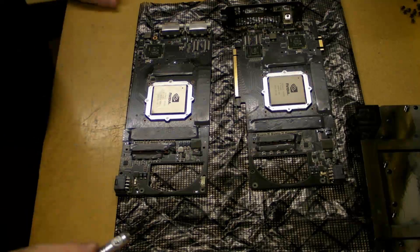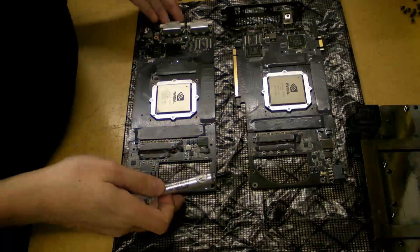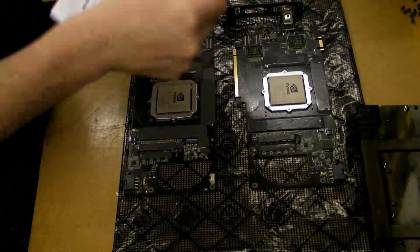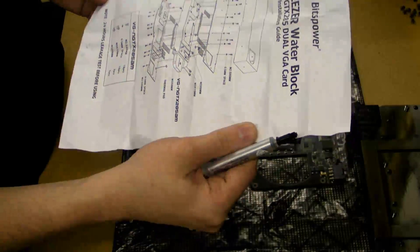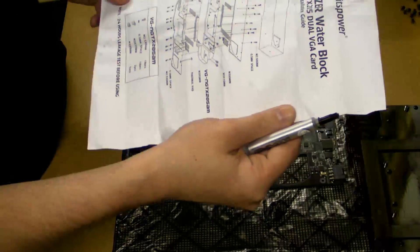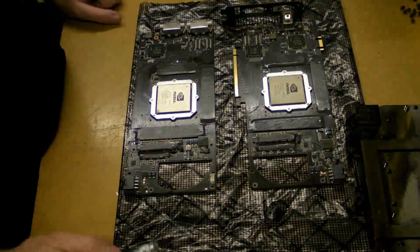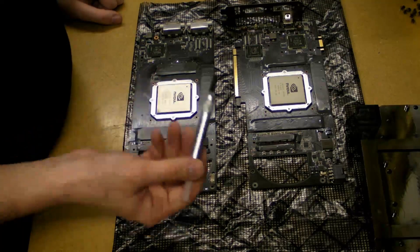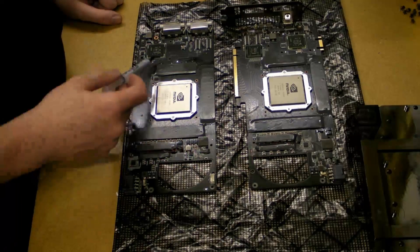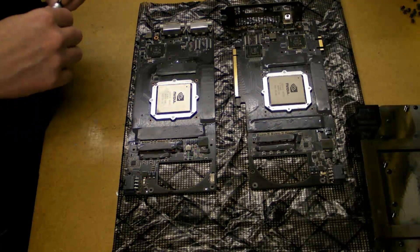Right, we're back again. We've got all of the parts marked out with the thermal pads in reference to the Bits Power diagrams — I use these because it's really not worth risking it, so I've checked and double-checked. All I need to do now is put thermal interface material on the two main GPUs and then the three side chips, one of which is an nForce NF-200 SLI chip.